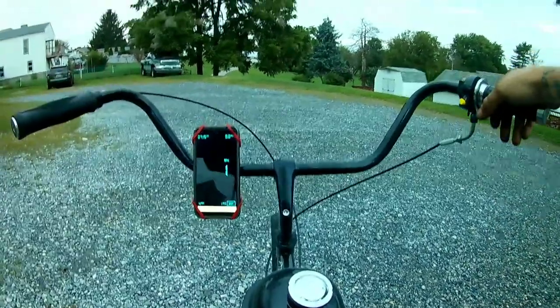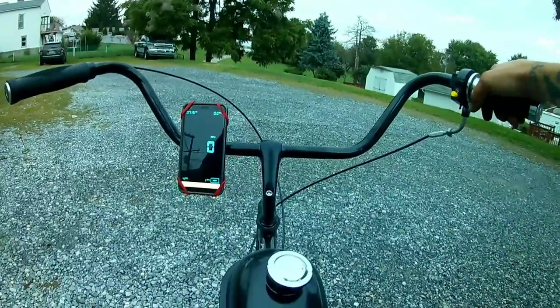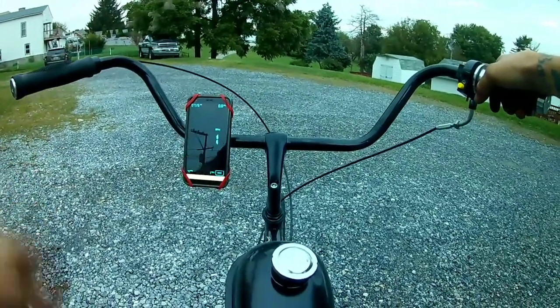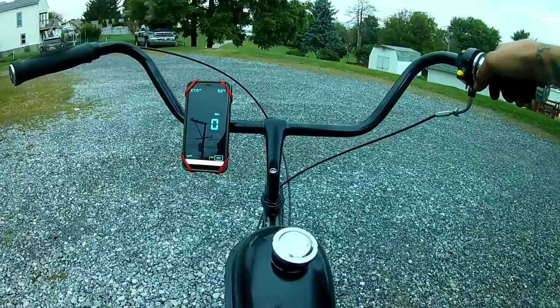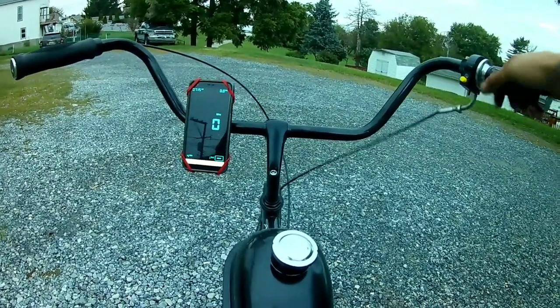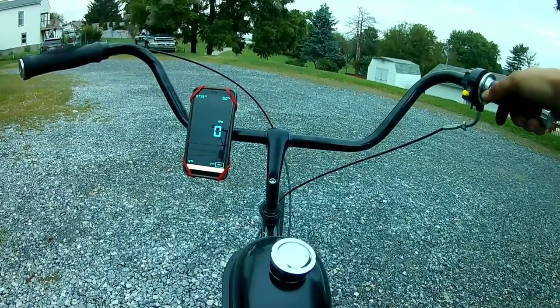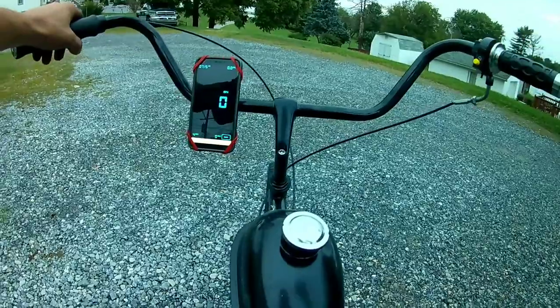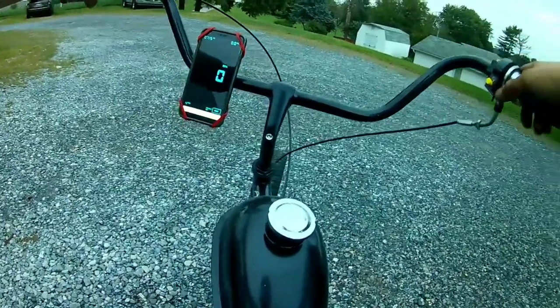All right, I'm ready for the test trip. I was checking things over, and I lied to you. I was feeling ballsy, I guess, and went straight down to a number 66 jet. We'll go ahead and give her a go. And I brought some stuff with me in case I feel I can go down some more.